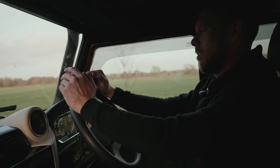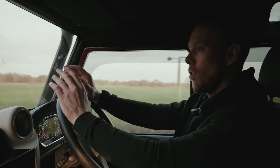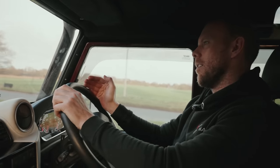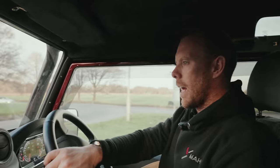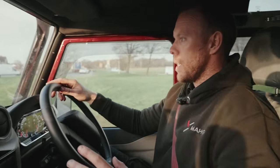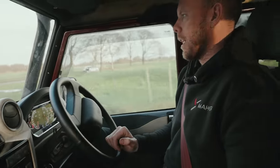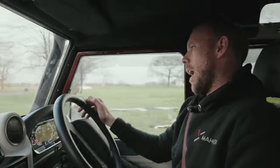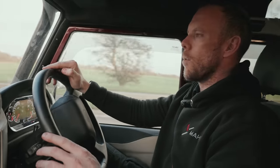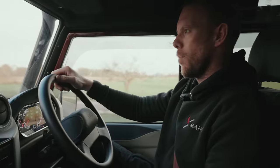So it's got Alcon brakes, it's got Drive Right air suspension, so it's all on airbags, lovely comfortable ride. It's got a 430 horsepower LS3, matched to a 6-speed auto, matched to a stage 2 Winchester gears. It's also got Winchester gear diffs, Ashcroft drive shafts, CV joints, you name it, it's got it. This car was basically, I don't want to say a blank check build, but it's pretty much there.